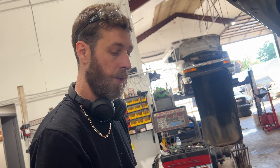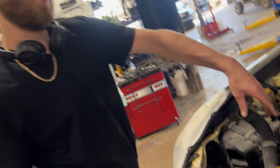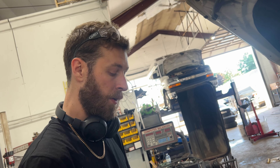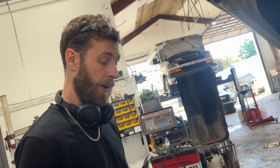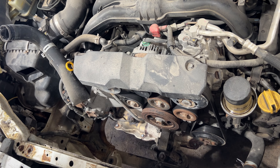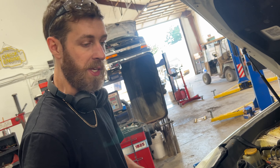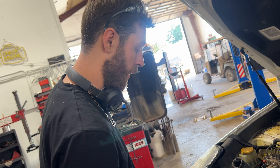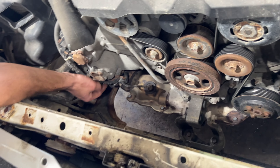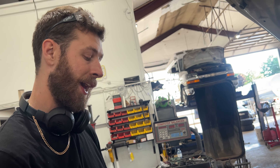To remove the exhaust manifold, there's one flange on the pipe that goes to the back with three nuts, and on either side there's a flange with three nuts each — 14 millimeter for all of the exhaust bolts. They were super rusty as well; I heated every single one and luckily they all came off without breaking the studs, but without that heat I don't think I would have got them off. Also keep in mind if you're going to take that manifold off, you've got to unplug the oxygen sensors — both connectors are right here.